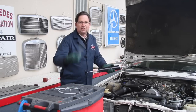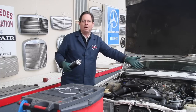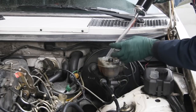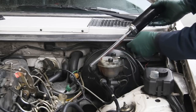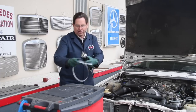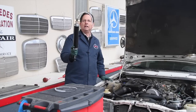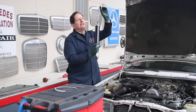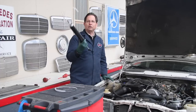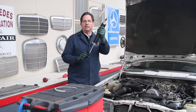The problem is this comes with just a big old hose on the end, and of course it works great for things like the power steering pump, but not so well for the brake master cylinder, and certainly not to get into the engine oil or the transmission fluid or the rear end fluid, or even a manual transmission under the car. So I came up with a couple of adapters like this, so you can adapt a much smaller hose on the end of this big extractor. This is ideal — you can go underneath the car on a manual transmission, pull that side plug, and actually get this up in there and extract the fluid out of a manual transmission or rear end using this.